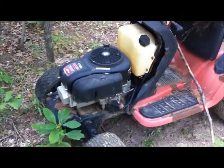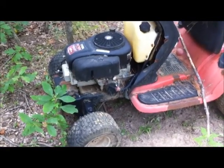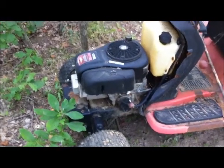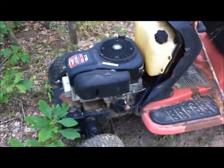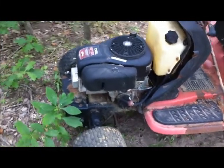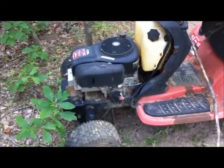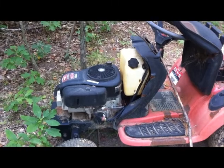So anyway, riding mowers are very underutilized. They have good power plants that can be used for generators, sawmills, whatever. But I'm thinking I would like to incorporate riding mower engines into the sawmill, but if the Kohler horizontal shaft works out, it's rebuildable, where I don't think these Briggs are. But these old Briggs, 12 horse all the way up to 18, 20 horse motors are sometimes free. Perfectly good motors and easy to change out. Already got pulleys on them. And with mower parts, you've got idler pulleys. You use the pulleys for clutches, whatever. So that's what I've got to work with motor-wise for the sawmill.